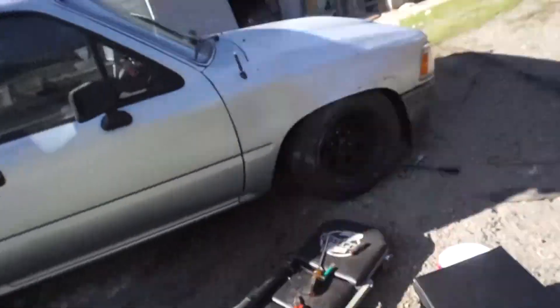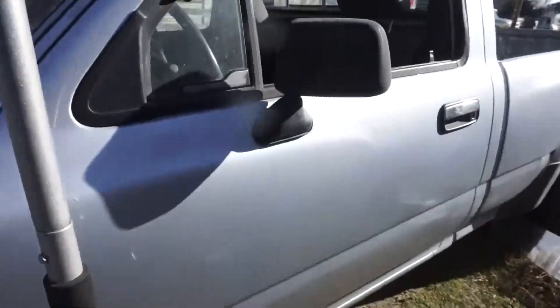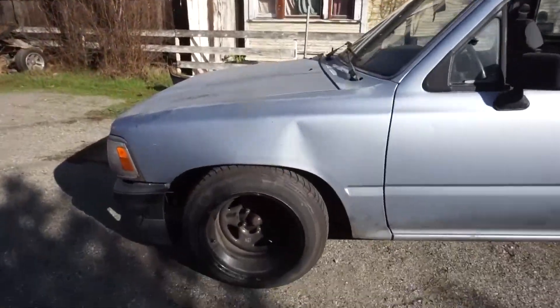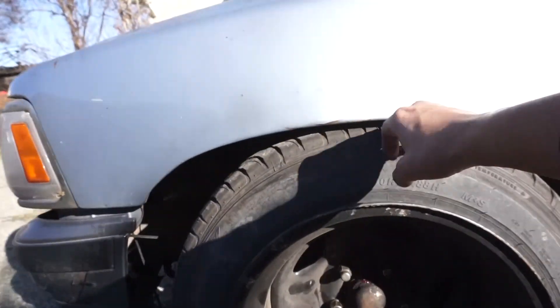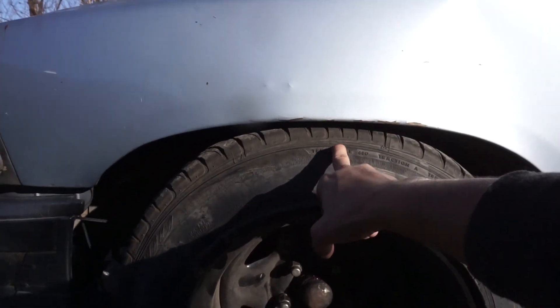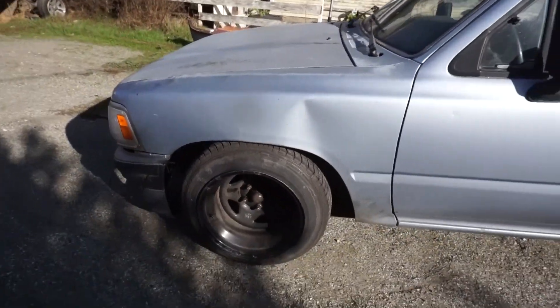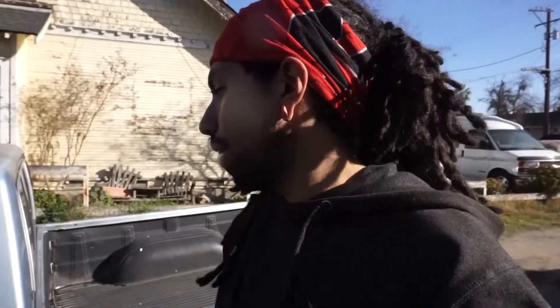Got this thing down to ride height and — holy shit — I'm tucking tire so badly that the jack got stuck under the car. So I raised it up and cranked the torsion bars about two inches. Fender used to be tucking to the second line; now I've got maybe a finger of clearance in between. It already feels a thousand times better. Now heading over to the alignment shop to see what they say, hopefully the truck's good to go.